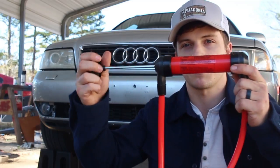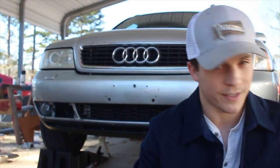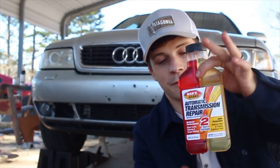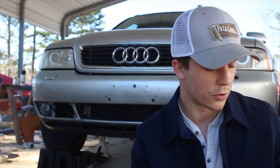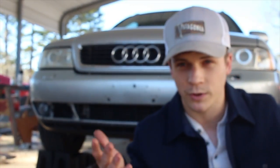Filling the transmission on this car is pretty straightforward, but you do need a couple of special tools. There's a drain plug and a fill plug underneath the pan, and you have to undo the fill plug and force liquid in, so you need a pump of some sort — I just picked this up at an auto parts store. I'm going to use some of this Bars Leaks automatic transmission repair. I know it's not actually a repair, but I've had really good luck with this stuff for power steering pumps on several different cars, so I'm going to try it on the transmission.